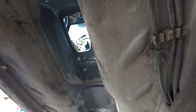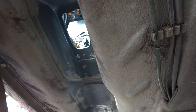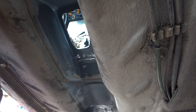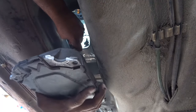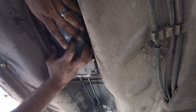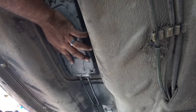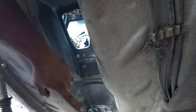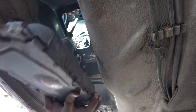Okay. The shift box. I cut the tabs off the shift box like I showed you guys earlier. I'll show you guys what it looks like after you cut them. Here you go. Just cut the edges off pretty much, don't need anything special. And it should sit all the way there. Now, you'll notice it's not all the way in because of these two bolts right here. We need to make the holes for them now and then go from there.